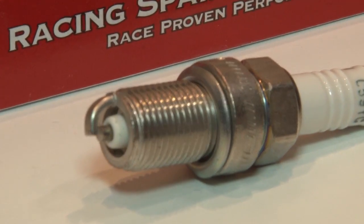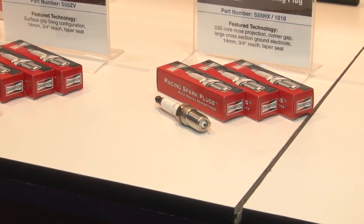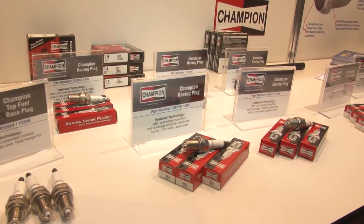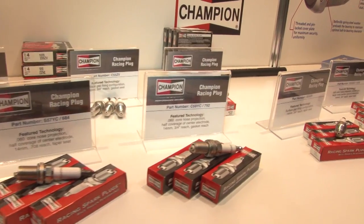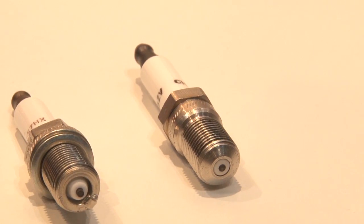After that you'll have the prefix in the nomenclature. Some designs are surface gap, which have no ground electrode, to some of the ground electrode styles which have either a short projection or a cut back projection. If it's cut back it helps keep the part from going into pre-ignition, and it also tends to have fairly good spark exposure. Another difference is the projection of the ceramic into the combustion chamber — a little projection is good, and if you can get some projection you tend to get better combustion.